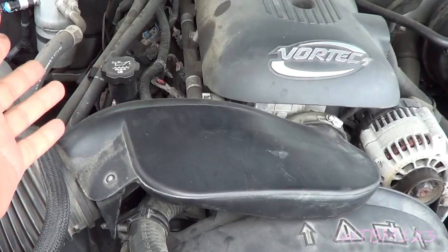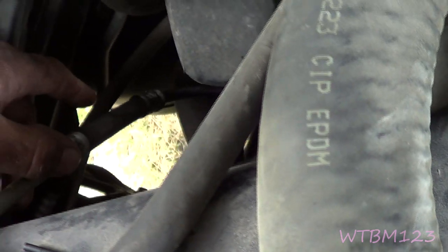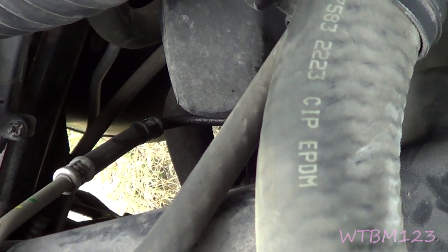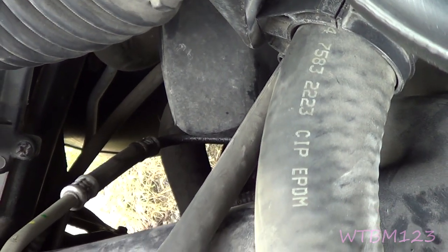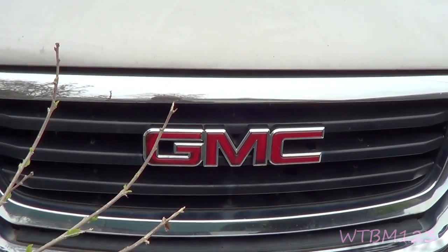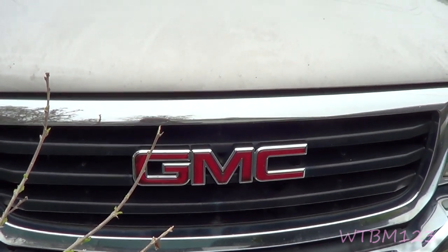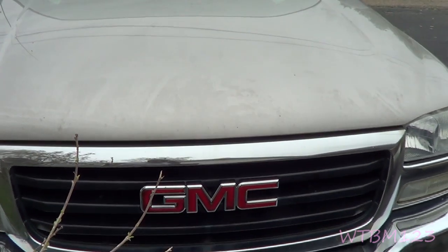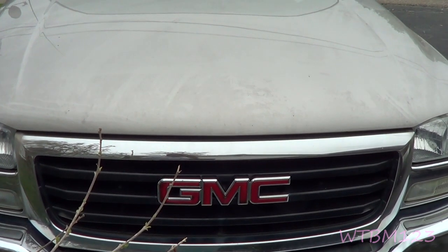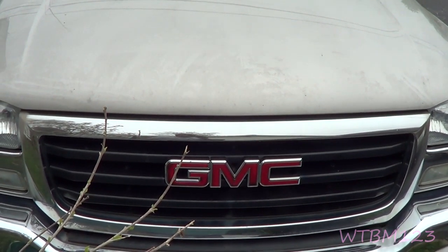So you can look to see if your bolts are there, if you're leaking antifreeze at the water pump gaskets or the thermostat housing, and if your transmission lines are leaking. After you've watched the video, go check out your Chevy truck to see if you've got all the bolts or not. I'm going over to Steve Robbs' channel — he's got a lot of good videos and a lot of other YouTube channels that you'll find from him that you might not even know existed.